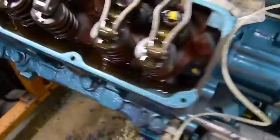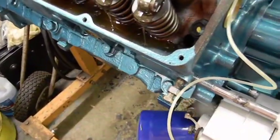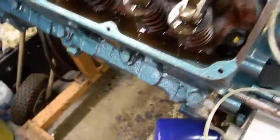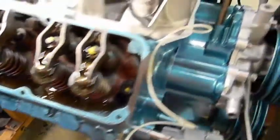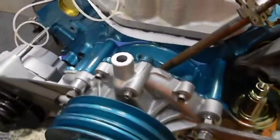How are we moving? Well, if I nail it, it's going to go all over your lap. The distributor spins half the speed of an engine. When it hits this regulator, it'll open up. Right now, 70 pounds is what it's at for ice-cold oil. And the drill's ready to smoke — it takes a big load. The heads are full. That's the problem with AMC: the heads fill up quick and they don't drain back fast enough. They say when you're going down the highway, there's a quart and a half suspended inside the motor — not down in the pan.